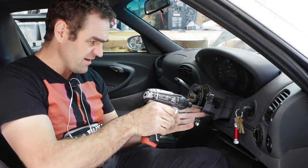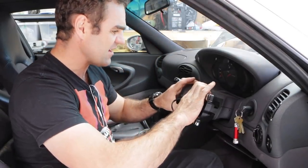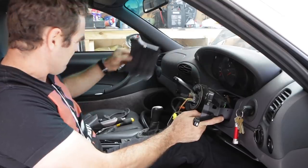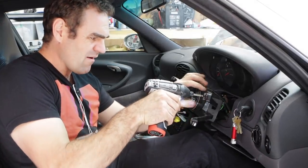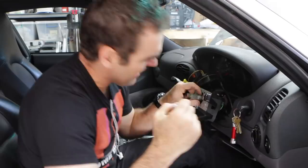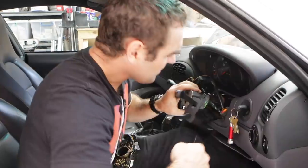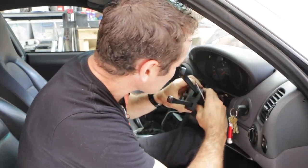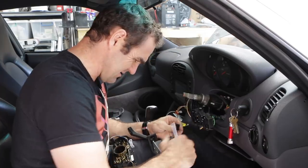Remove the face cover - just four screws. Face cover comes off. And two more screws either side - that slides up and out. Bottom slides down and out. Unscrew here. Mark the distance out on here. Then underneath there's just an 8mm nut. And now there are two big plugs on the back that you need to disconnect. There's one, there's two. And then the last little plug is out. Done.